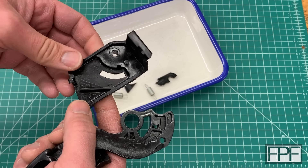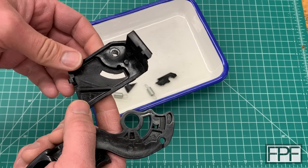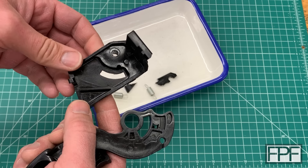So I want to try and make this out of ABS plastic. I've never printed ABS — I've avoided it because of the potential harmful nature of the fumes. I think I have a solution for that, but either way I've still never printed ABS. So that's going to be a challenge in itself. I think I'm just going to go start designing — measure and draw this piece to the best of my ability — and then start test fitting both in the car and the handles to this piece to see where things are lining up. I'll prototype in PLA because that's going to be fast and easy, and then as we get close to a final design we'll tackle the ABS piece.